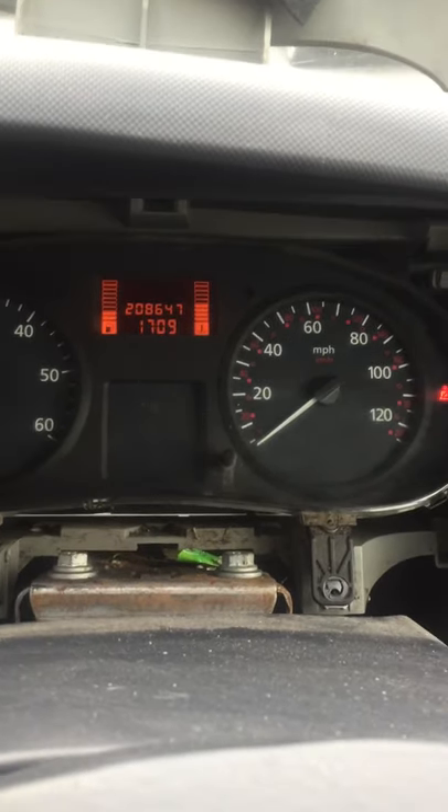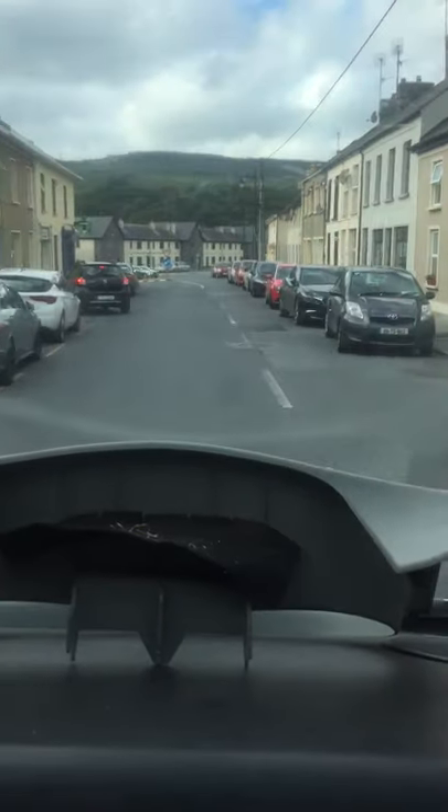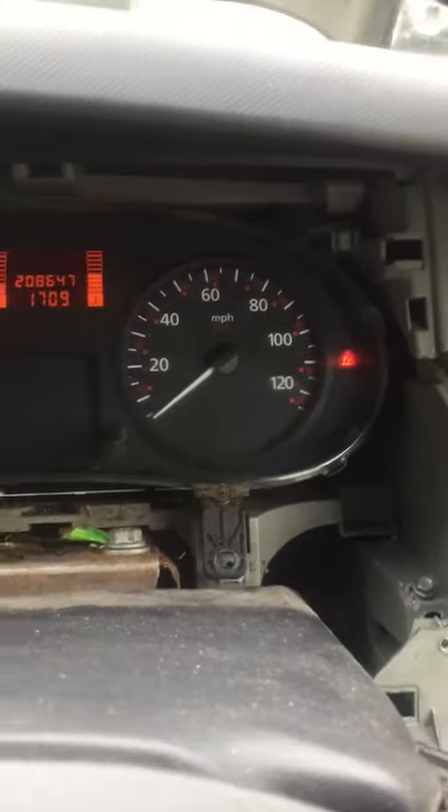I found this interesting and maybe it might help somewhat. We're in a 2008 Renault Trafic — a little Vivaro. We're starting to move, only for test purposes. Look, our speedo is not working. The tachometer is working but we are moving and driving okay, so the speedo is not doing its job.